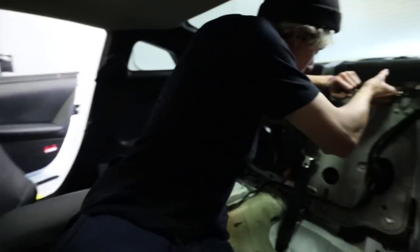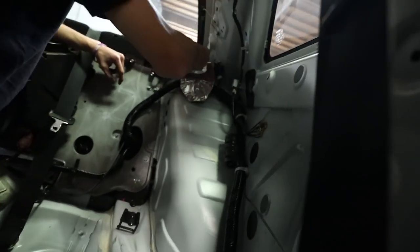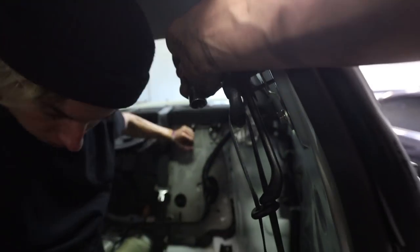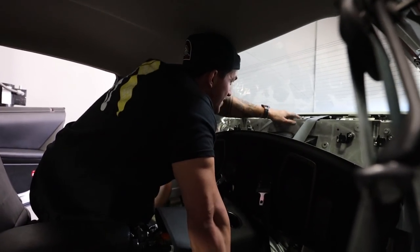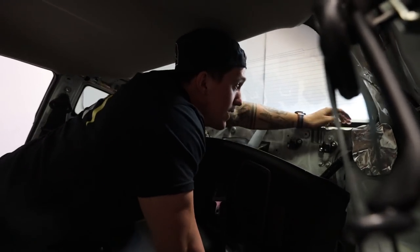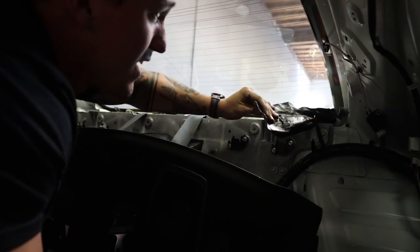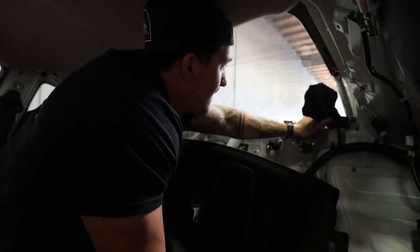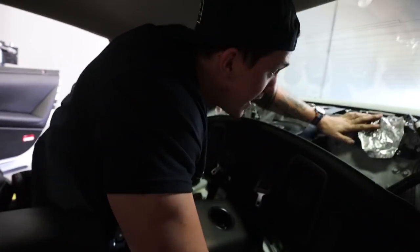On the interior of the car, like I said last night, you literally have to remove the entire rear interior. All the panels on the driver's side have been pulled off. We're pulling off the back carpeting, and once the back carpeting is finally off, the top hat should be right there hopefully. After all of that, we just had two clips to take out. According to the forum, we remove this sound deadening right here and the top hats are exposed. Now we just get in here, loosen those up, and drop it.